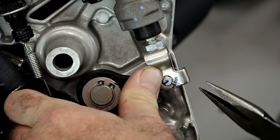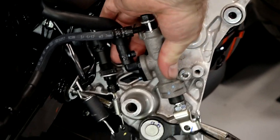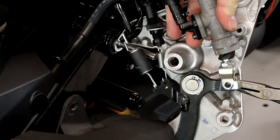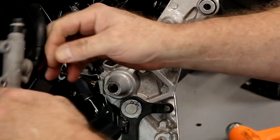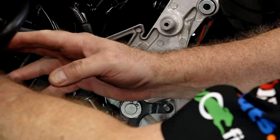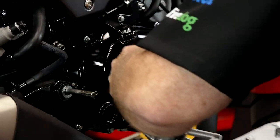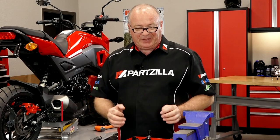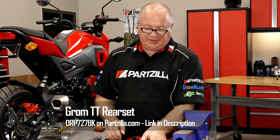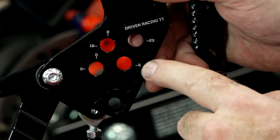Let's start by getting this cotter pin out of the way. That pin won't push through unless I get the body unbolted. Let's see if we can get that pin to spin around and clear — it doesn't give you much clearance there but it will come out. Next we just need to follow our brake light wires up to a clamp and get that to pull loose. Everything's pulled apart, but before we can start putting it together, we need to decide where we want our foot pegs to be. They have multiple locations — I'm going to pull it back to the five location on both sides.